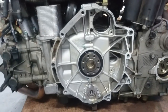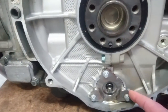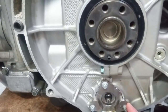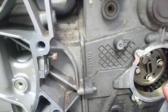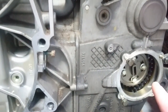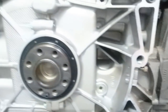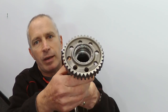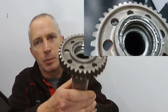We're looking at the back of an M96 engine here. The things that are immediately obvious: we have the back of the crankshaft, and just below it we have the intermediate shaft bearing cover. Just behind that sits the intermediate shaft bearing, and then off to the side here we can see one of the camshafts that will be driven from a chain that goes from the intermediate shaft across to that camshaft — and mirror image on the back of the engine on the opposite side. I'll include some pictures that show that this bearing face is rather the worse for wear.